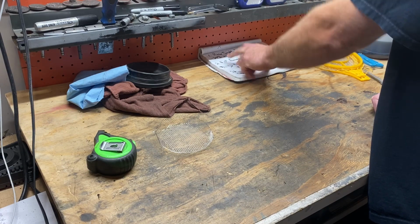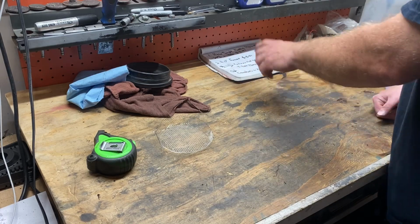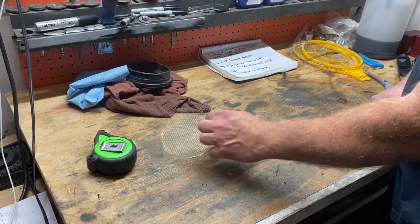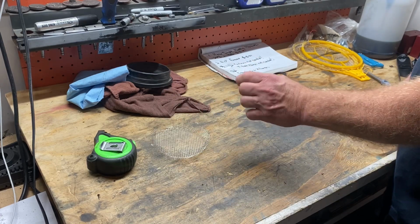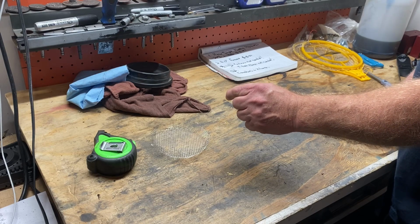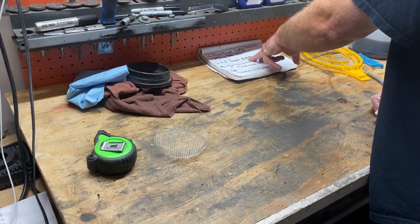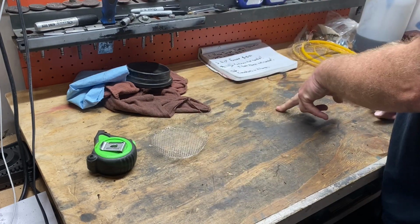Fernco, like they use in plumbing, which will actually have 2 ends to it that'll come with its own clamp and rubber that you would just cut to create your whatever, you know, because turbos have different depths on that inlet. So you'll just cut a piece of that rubber off that Fernco that's whatever width you want. You've got 2 chances of setting it up right, because on that Fernco, which I found online for $8, you got 2 chances, or you could make screens for 2 turbos with 4-inch inlets.